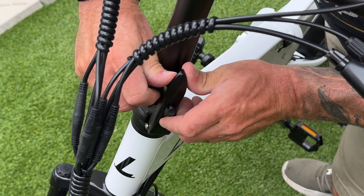To move up in pedal assist levels, hit the plus button — the display shows all five levels. Use the minus button to go down. To turn the headlight on, hold the plus button until it comes on; you'll see the headlight indicator on the display. Hold plus again to turn it off. This front headlight, although small, seems brighter than other e-bikes in this category. When the headlight comes on, so does the taillight, and whenever you hit the brakes it brightens up. The brake function still works even without the headlight on.